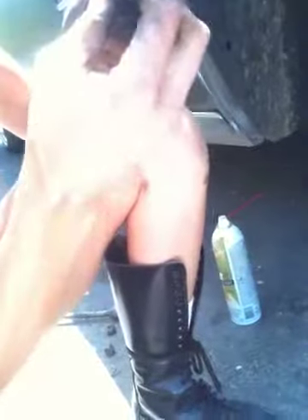Here we go. One nice thing is it's pretty self-explanatory where this clip is going to go — the wide part holds that one and the skinnier part holds the top one. I usually go top first. This better work for me because I'm having difficulties today; this usually goes a lot quicker. I guess cheap brake pads — not cheap clips, but cheap brake pads and whatnot — made in China.